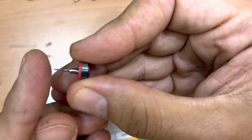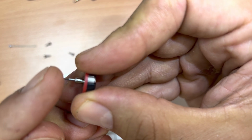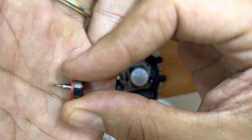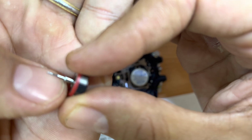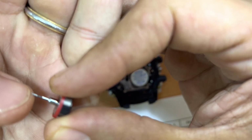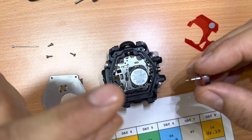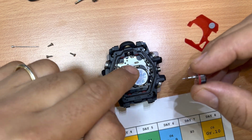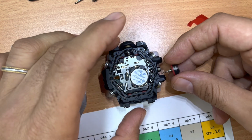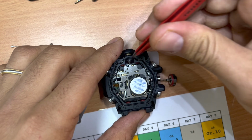So this crown is supposed to be about this much longer. This much is missing. It's a very pointy, sharp edge with a very interesting structure to it. It's thicker on this side, then you have a little bulbous part, and then it becomes thinner. And the thinner part, if you look under a loupe, you will notice that it is a square shape to help tick the mechanism inside, and those are the clicks that you feel as you are rotating your crown. Unfortunately, that's not the case here anymore.